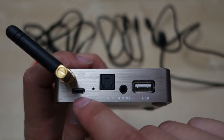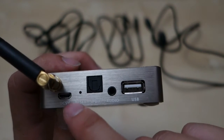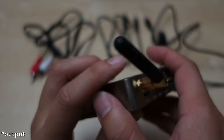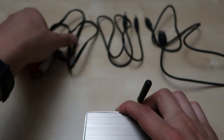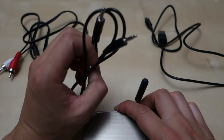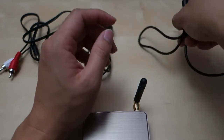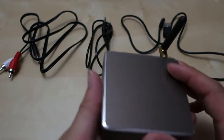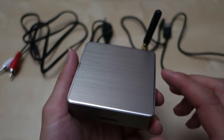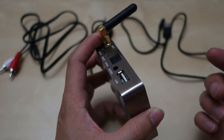It only has Wi-Fi — there is no Ethernet on this unit. On the back you have a DC 5-volt input, a reset button, an SPDIF input for audio, and then a USB port. Besides the unit you also get an RCA to 3.5mm audio cable, a 3.5mm auxiliary cable, and a USB to micro-USB cable for powering the unit. I found that you can use your TV or anything with a USB output at 5 volts to power this unit and it works fine.